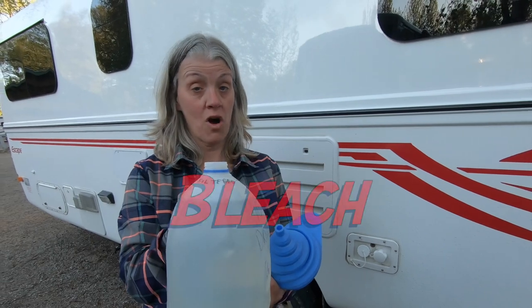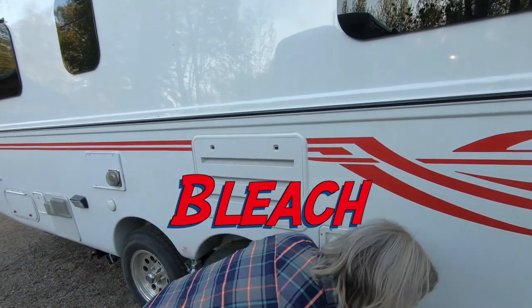The first step I've taken is mixing water with bleach. The ratio you want is a quarter cup of bleach for every 15 gallons of your tank. These are 28-gallon tanks so I've mixed in just under half a cup. I've also turned off the hot water heater and put it in bypass mode — you do not want this bleach solution to go into your hot water heater. It should stay in your tank for anywhere from 4 to 12 hours.